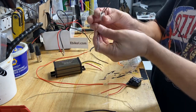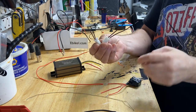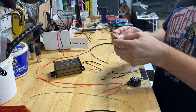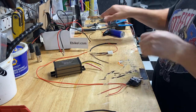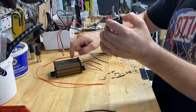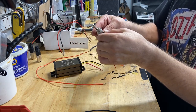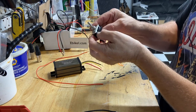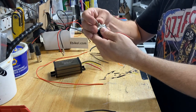We need some connectors for your accessories. I always put the red side on the notch and the negative is always on the other side. I have a switch here and this will be the on/off switch to power the DC converter. This is a household-duty 20-amp 125-volt AC switch — that's not an auto toggle switch for 12-volt; this is for house lights.